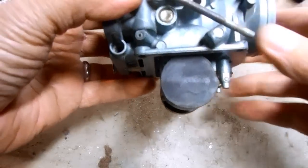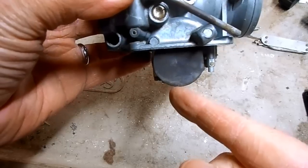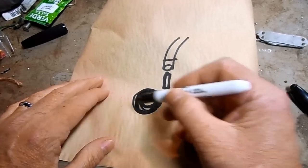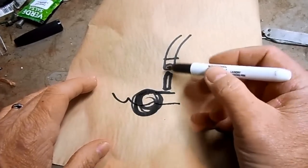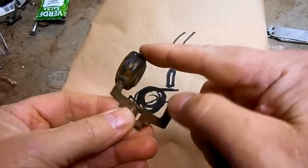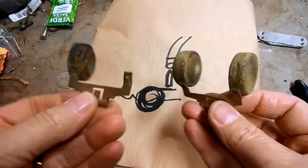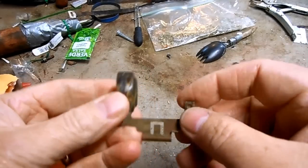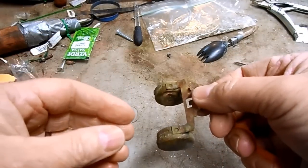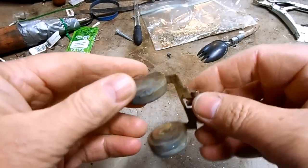With this example carb, when the float goes up it turns the gas off, and when the float drops the gas comes back on. If the float's broken and doesn't float in the gas, fuel will just continue to flow. Brody's float is supposed to have two floats and one's broken off — it should look like this. Floats don't have to be broken to fail; they can just be leaking, and when they leak they'll sink in the fuel, leaving the valve open and flooding everything.